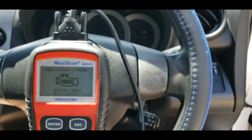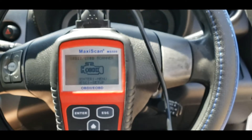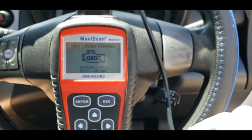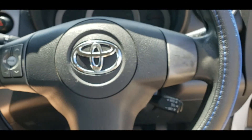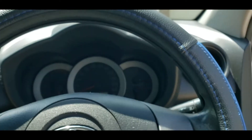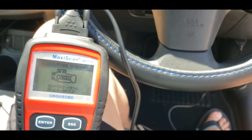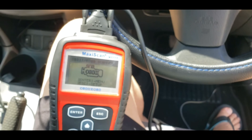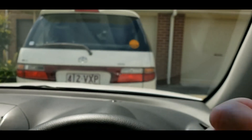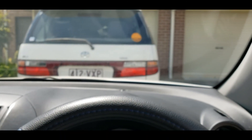That's just an overview of this Maxi scan. If you've got any more questions, leave them in the comments and I'll be glad to answer them. If you get a linking error on a newer model car, you can unplug it from the OBD2 port, wait 10 seconds, turn the ignition switch to off, then plug it back in and turn the ignition switch to on again — that should clear the linking error. If you like this, give it a big thumbs up, comment below, subscribe if you're new, and see you later.